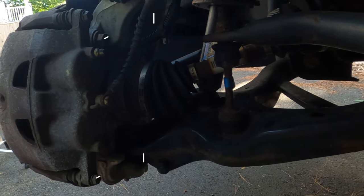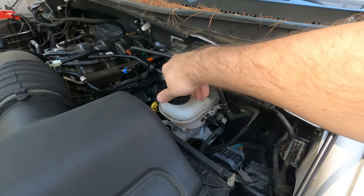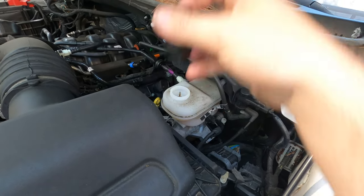So we're going to see where we can get with that. I like to remove the brake cylinder cap to make sure that as I'm pushing any of the calipers back, the fluid can flow back up and there's no pressure in the system. Now let's go ahead and jack the car up, get it up on jack stands, and take the wheel off.